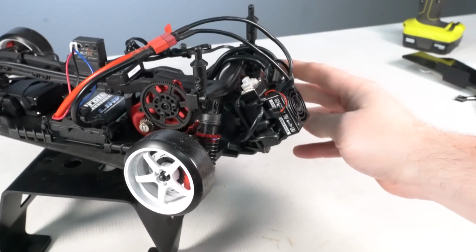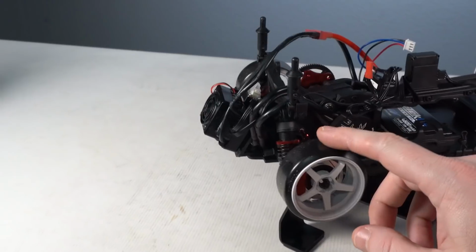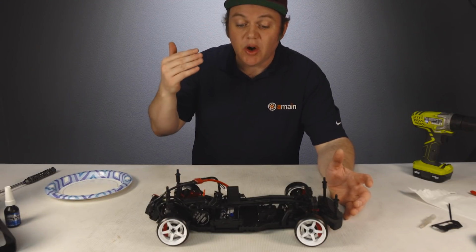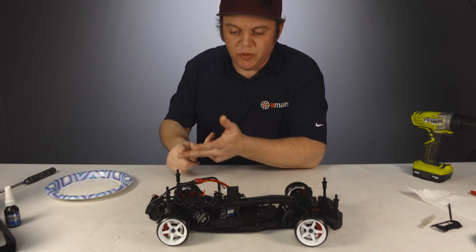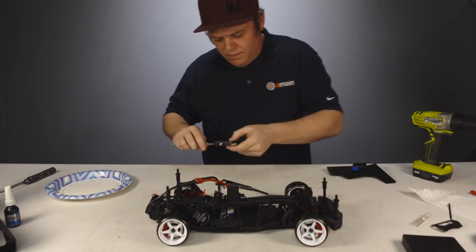Boom! This took maybe half an hour to mount that back there. It was really easy. So let's put it back on the scale and see how the weight distribution has changed. We need to first reset our ride height because the car is slammed in the rear end. We're not gonna drive it like that. So we need to reset our ride height to where it should be, and then we can reset our camber to where it should be, and then we can put it on the scale.